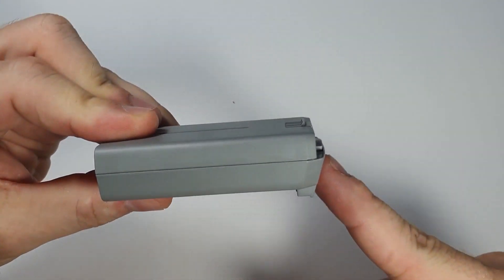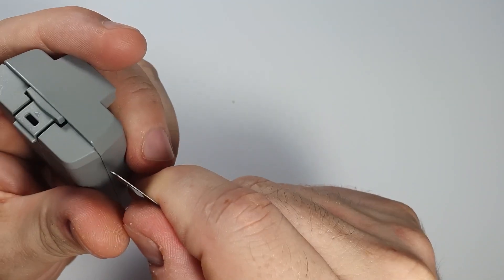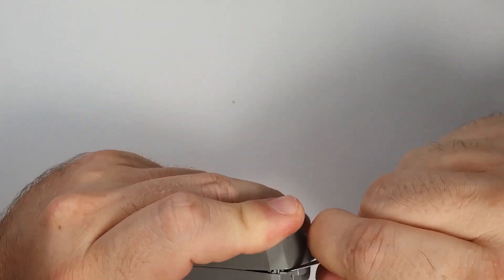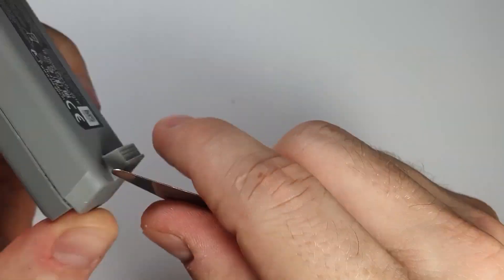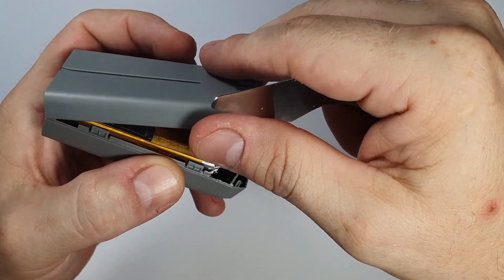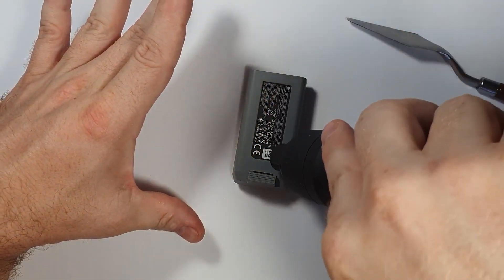The cutout voltage is 3.5 volts per cell. I'm not going to bore you with a long video on how to take the battery apart. This is the lid I'm going to remove. I'm using this metal spatula and this is the place where it is possible to start taking apart the battery. This is the prying motion I used to pop it apart — it took around 10 minutes and close to no damage to the plastic battery casing.